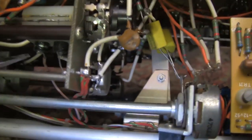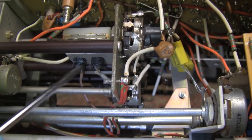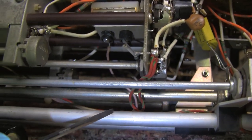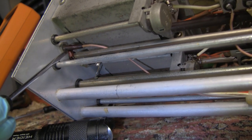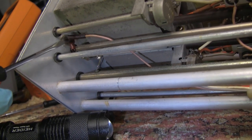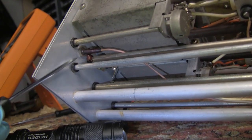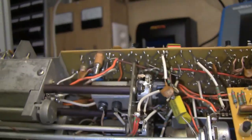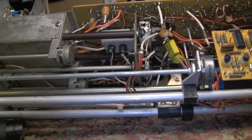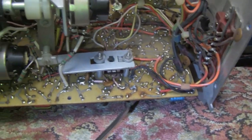On the other side at least both wires are connected. However, this pink wire — when I follow it to its destination — is not connected, and there are burn mark signs there. It looks like this bulb shorted out at some point and caused the problem. So I need to fix that, fix all these contacts, and then I'll show you what else I found.